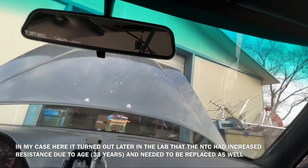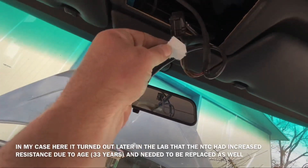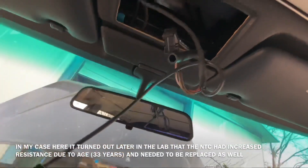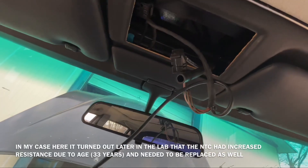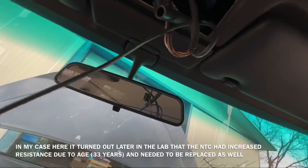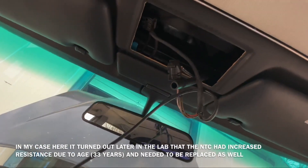The air suction should hold the toilet paper to the hose, and that's not the case, which means the pump is out. It's on one of the fuses, and when you have the fuses checked and you have no power there, then that pump is out.